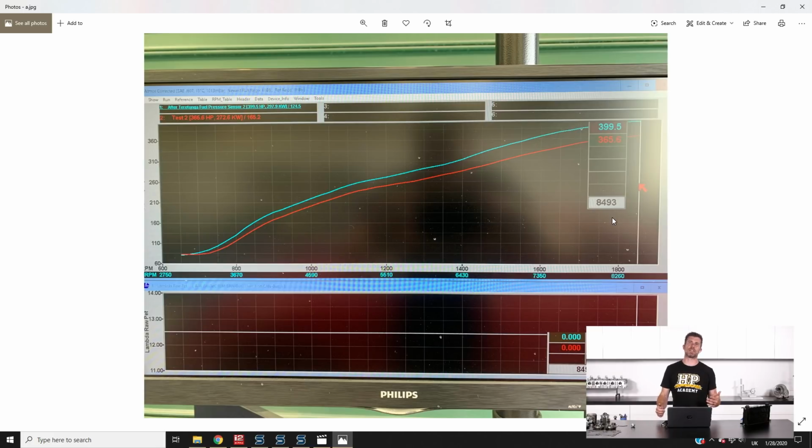That would have saved us a lot of time if we'd been at the track. Generally you'd end up chasing your tail for a couple of practice sessions with an issue like that, particularly if you don't have a lot of data. It can be quite tricky to diagnose where a misfire like that is coming from. With the individual bank lambda, we could straight away diagnose which bank of cylinders the misfire was coming from. Then by holding the engine under light load and unplugging the coils individually on that bank, we could highlight which individual cylinder the issue was on. So it makes diagnosing really quick and easy. If you are racing competitively, it is always a good idea to frequently dyno test your car, even if not making tuning changes, just to keep track of where it is.